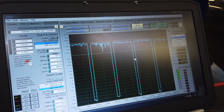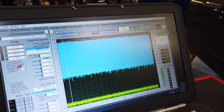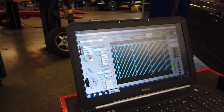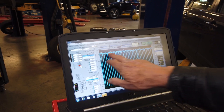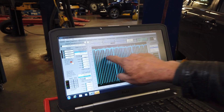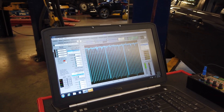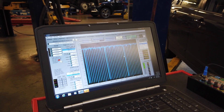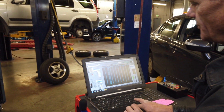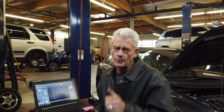This is another bad area right here where we're dropping near a full volt. In the zoomed-out view we've got a ton of hash on this signal — the sensor signal is not clean. We have a ton of voltage dropouts in this square wave, and when this drops down to about 3.66 volts any spike exceeding that is going to intrude on our signal and trigger code P0335. So I believe this car needs the crankshaft sensor replaced. Let's go ahead and put the crank sensor in and re-evaluate the signal afterwards.